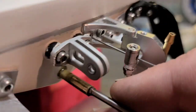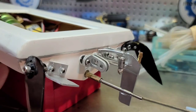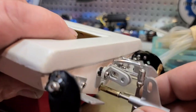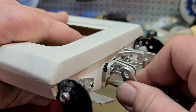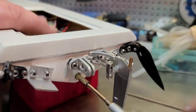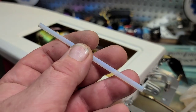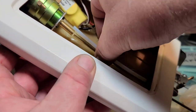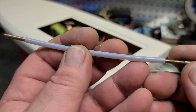After a couple trips out to the shop I got it exactly where I want it — it's in the coupler, all the way up into the coupler on the motor, and that four-millimeter section is barely sticking out the end of my stuffing tube. We slide our strut over the eighth section of the shaft and it should line up with the holes in the mount. Got a little bit of wiggle room there, so that looks pretty good.